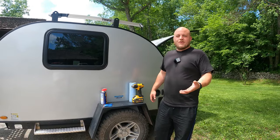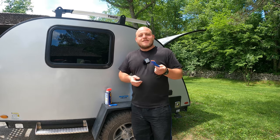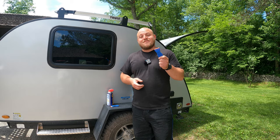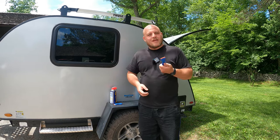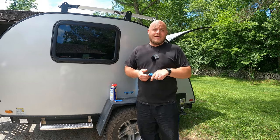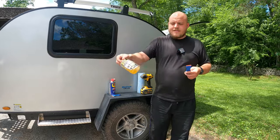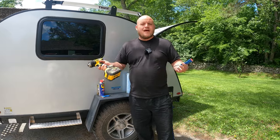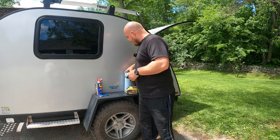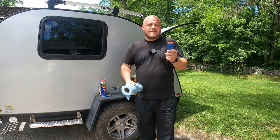To do this job really only requires a couple simple tools, but some of them are essential. The first one is a plastic razor — I'll include a link in the description. I can scratch as hard as I want and I'm not going to scratch the camper. It's also just about as sharp as a metal razor blade, and a lifetime supply costs about $9.99. I also use WD-40 and sometimes Goo Gone. You're going to need a heat source — a hairdryer works fine, or a cordless heat gun works exceptionally well. I also like to use either an old t-shirt or disposable Scott's towels, which are a little more rugged than a paper towel.